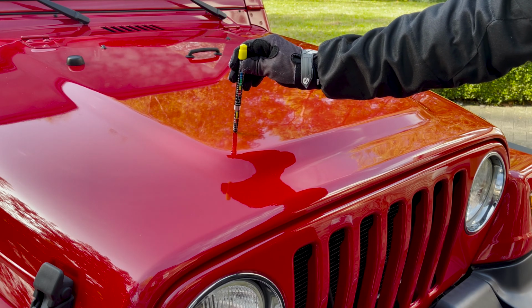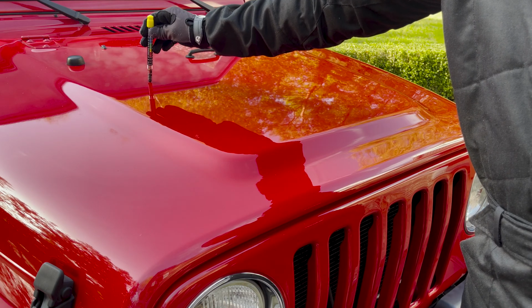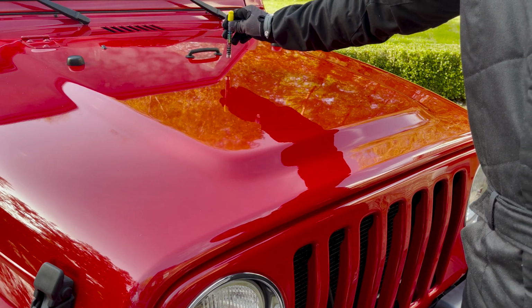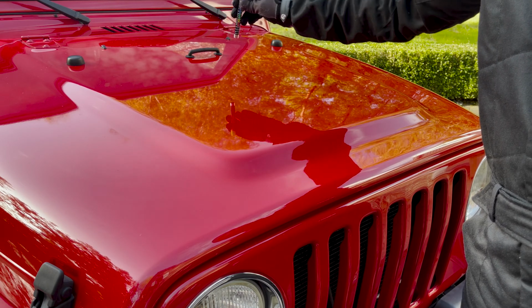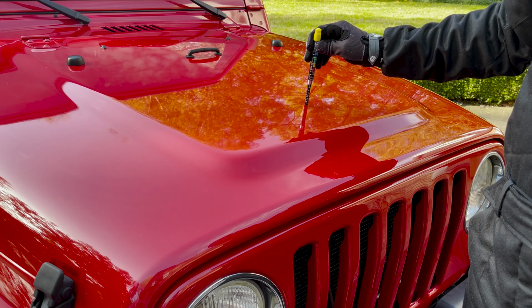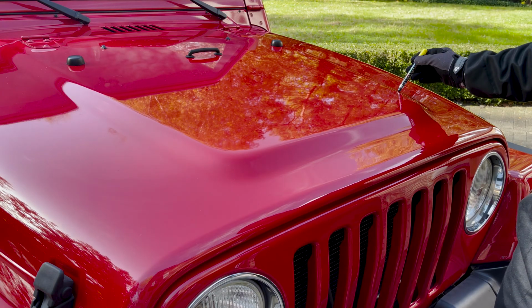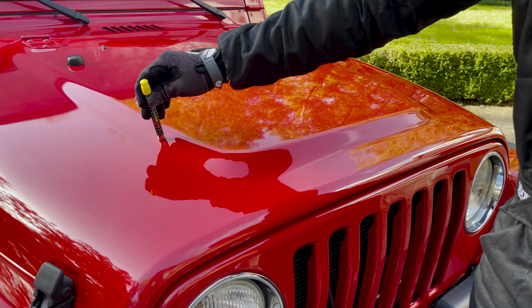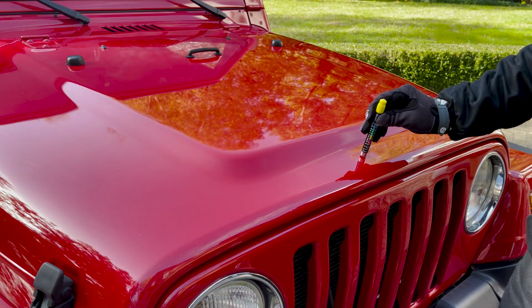You want to measure paint thickness in many different spots because some panels may have been resprayed or polished hard to remove a deep scratch. What these devices do is measure paint thickness. A mechanical one measures paint thickness on steel parts using a magnetic steel ball on a spring-loaded extendable pen with a color scale. The thinner the coating on the surface, the stronger the hold or pulling force the magnetic ball will have.